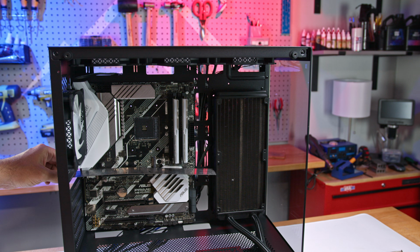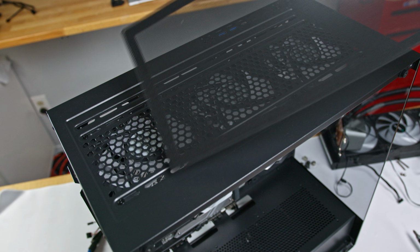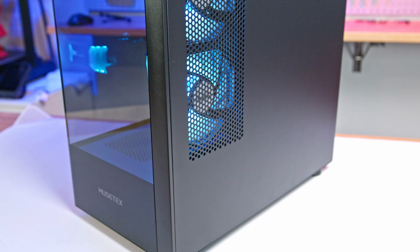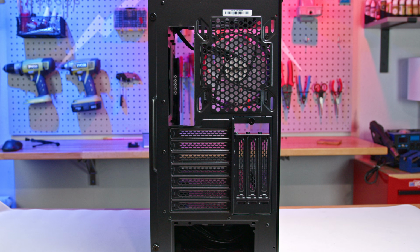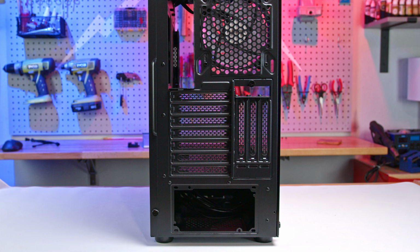Do note that this will reduce the maximum PCIe card length to just 290mm. Dust mitigation might be a concern as the case only has removable filters on the top and on the bottom under the PSU, with the main intake points on the side and bottom left filterless. You'll find 7 replaceable PCIe covers for horizontal PCIe device mounting and 3 for vertical configuration.